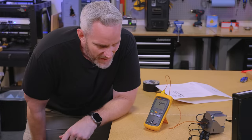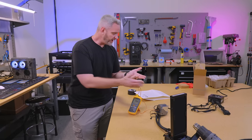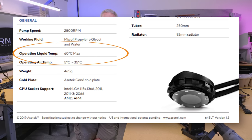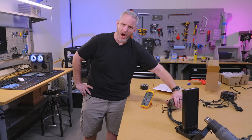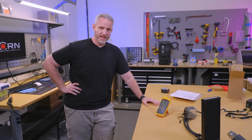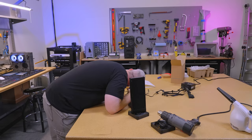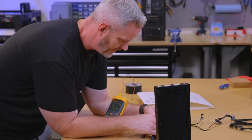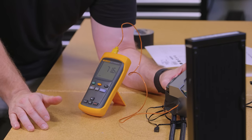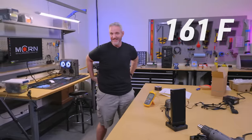If your fluid was this high already, very bad things would have had to happen - your pump also has a maximum operating temperature. Most water pumps like DDCs have around 60°C max. I'm trying to look carefully to see if anything's happening. Right now it's so hot, and I want to make sure I don't get scalded at 57°C. The pump is barely turning. The thermocouple had come off the cold plate, but as soon as I pressed it back down, that's reading the actual internal fluid temperature: 72°C.